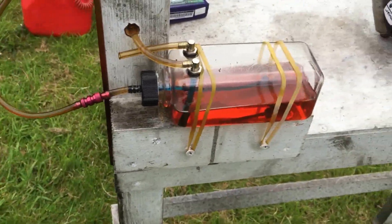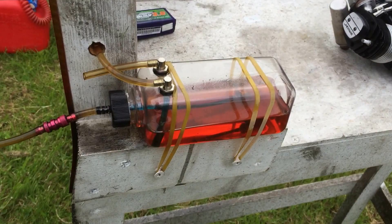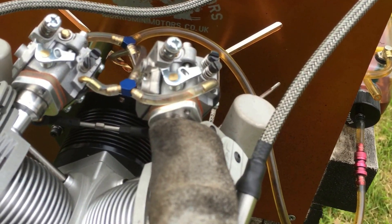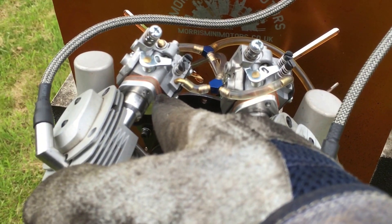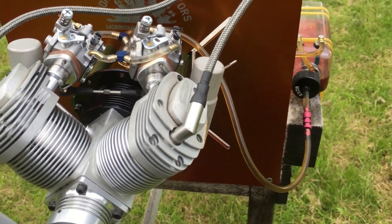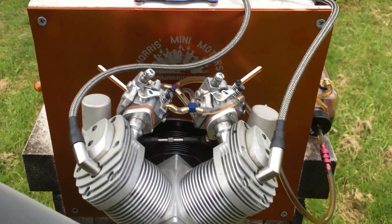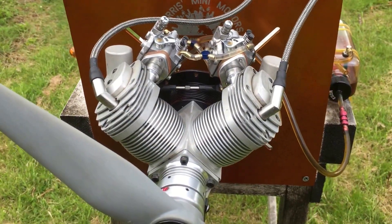Regular stuff: 20 to 1 mix, I'm using a Redline two-stroke racing oil. I'll mention in this video — because I've been getting quite a lot of questions — about where you get the pulse for the pump to operate. If you can see, there's a slot in that heat spacer that sits on top of the carburetor and goes back into the intake manifold. That creates a vacuum body pulse for that carburetor. Do you have to drill into the crankcase? No — that's already been machined into the heat spacer for you.